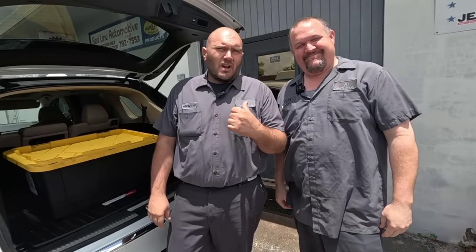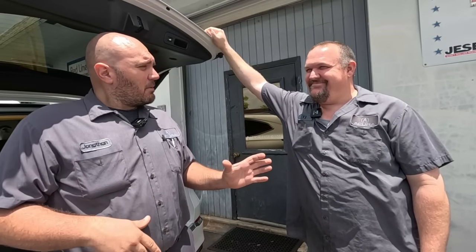All right, so the block's dropped off. They went through everything that we're gonna do. They asked me how much boost the engine's gonna run. I guess that helps set the ring gap and the bearing clearances. I mean, I know supercharged is really more of an NA kind of build on top of it, but they wanna know everything. They're gonna use a torque plate when they do everything. I don't know what all that means, but apparently it means something good.